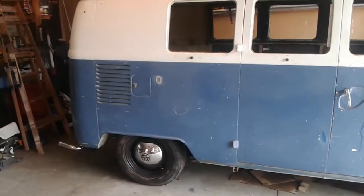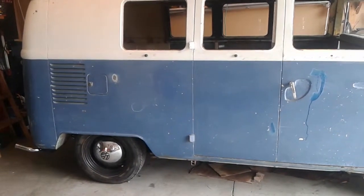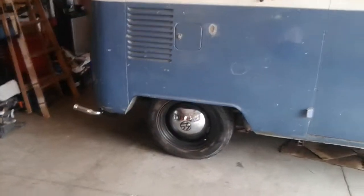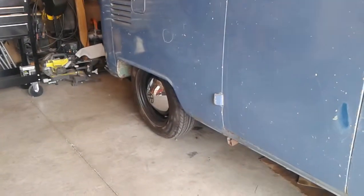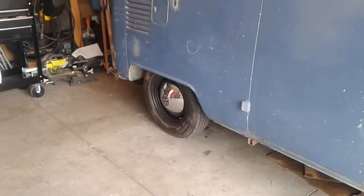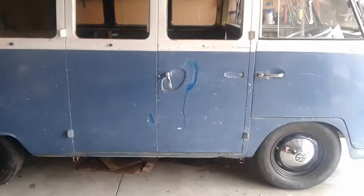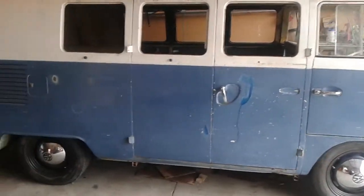With the spring plate set up in the back, with the gear reduction boxes removed, that is the rear. I may go down another notch in the back because I got a little bit of positive camber on the tires. And it's supposed to be lower with a straight profile on those tires. It's supposed to be able to do that. So I'm going to take it down one more notch. And that mild rake that the bus has in the front will probably be even.